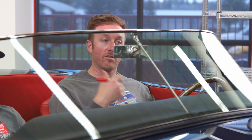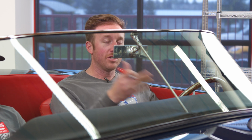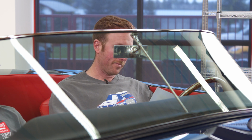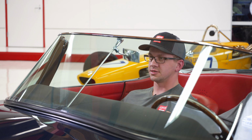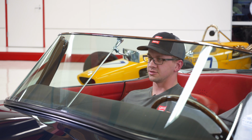Yeah, and those gray edgeless towels, I think my best use for them is polish removal. And if you're doing a lot of toweling trying to absorb a liquid with them, they're not as absorbent either, so you're going to be pressing the towel on the paint more, which increases your chance of leaving toweling marks behind. Porsche Black is a real bear, but get yourself a couple sets of the plush edgeless, the blue towels. They're excellent on anything that's incredibly soft.